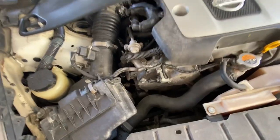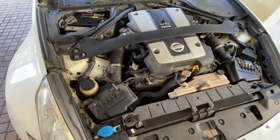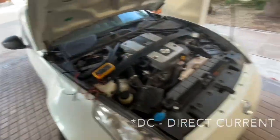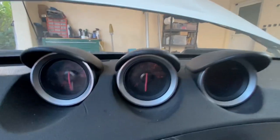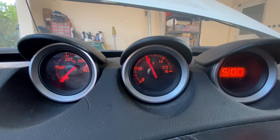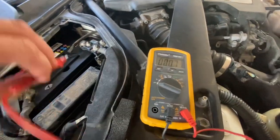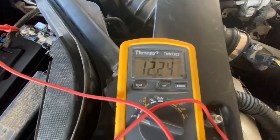We'll check that the wiring isn't grounding out anywhere, and that the connections on both sides of the alternator and the battery terminals are tight. The only thing left to do if that shows no problems is to remove the alternator, bring it to a shop, get it tested. We've set up our external voltmeter and started the car — we've got 12 volts at the battery.